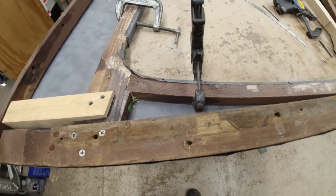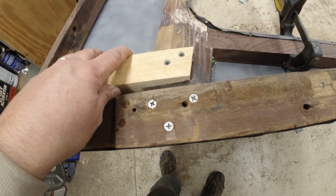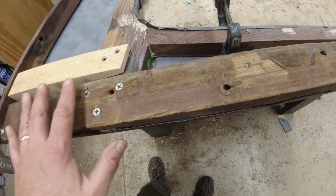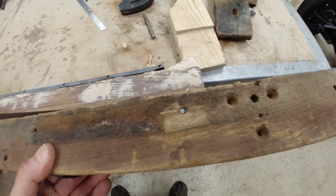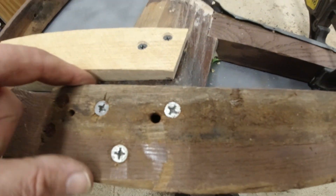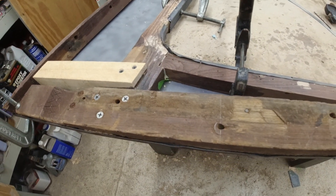I made a small change — I realized I could put this board back in and get it into the exact holes, set in the exact spot, then cut a piece to fit in here to hold this piece in place relative to the other. Now I'll be able to take this piece off, take this out of the sheet metal, and lay the new beam — or new sill — in and cut a slot for it. This should be much more accurate because everything's in the right position. This went back in the same holes, and it's a nice snug fit here.